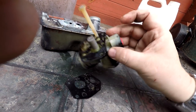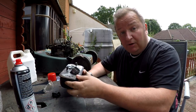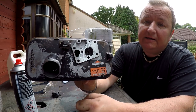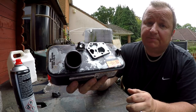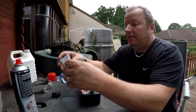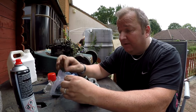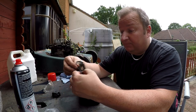Giving the tank a good blow out now. I use carb cleaner spray in conjunction with an airline to blow them out. As you can probably see, that little chamber which was full of crap is now totally cleaned out. That is actually spotless now - there's no rust. Now it's time to install a new diaphragm. These aren't genuine ones, they're pattern ones - a lot cheaper. I've only had problems with some of these pattern ones but all in all they're pretty much okay. If in doubt, get the genuine ones.